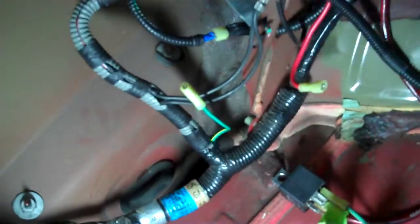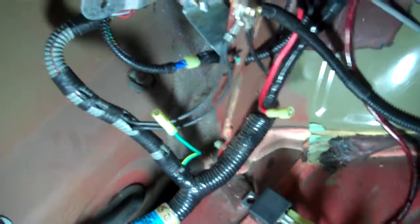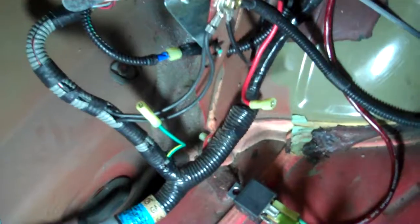Also, a lot of people buy, sell, and trade these items. So if I ever switch up my fuel system and no longer need my booster pump, all I have to do is unplug it instead of cutting all my wires out — it would probably take me 15 minutes to get the booster pump out and it's ready for somebody to reinstall it on their car by only cutting their CCRM wire and putting connectors in. Now that it's installed, it's completely removable and will stay completely together. That's one reason why I've only used connectors on this.